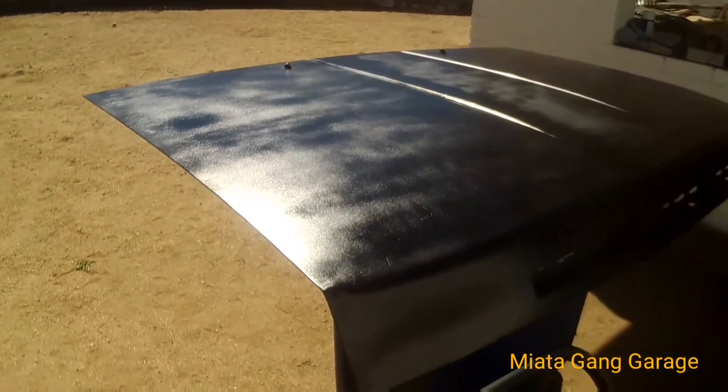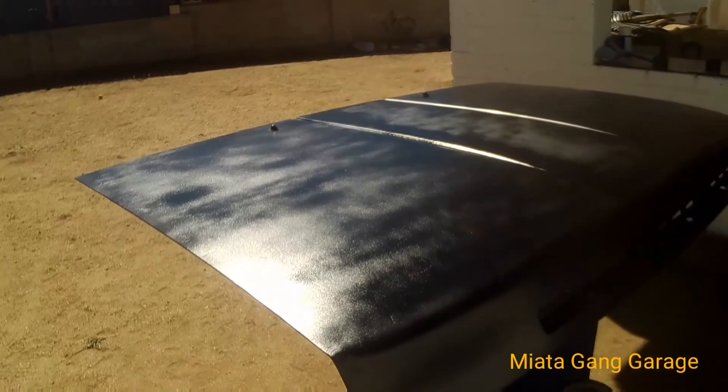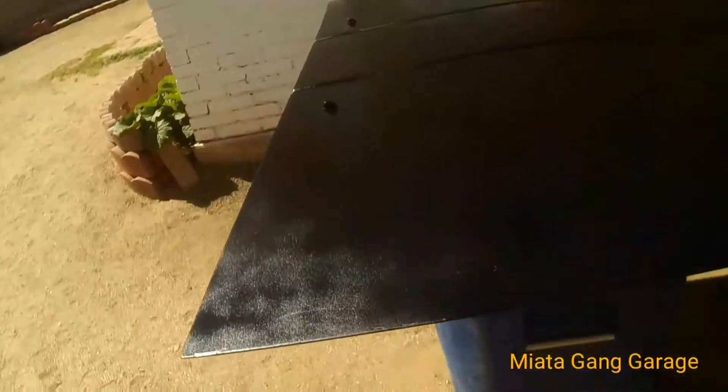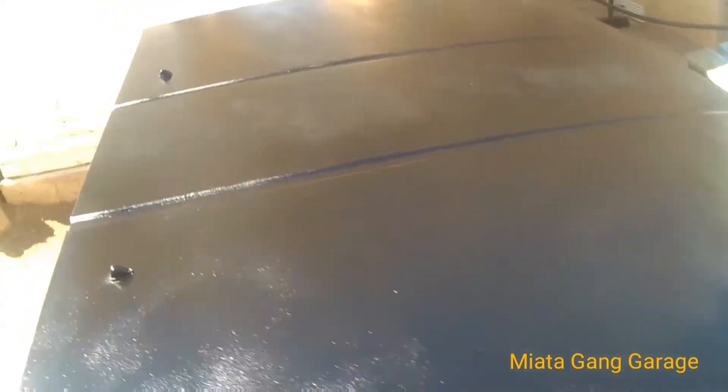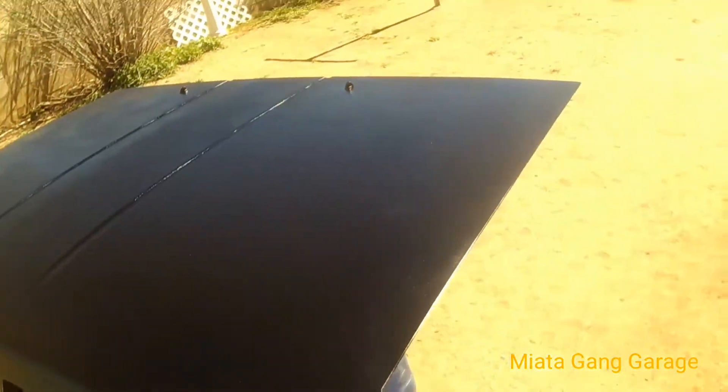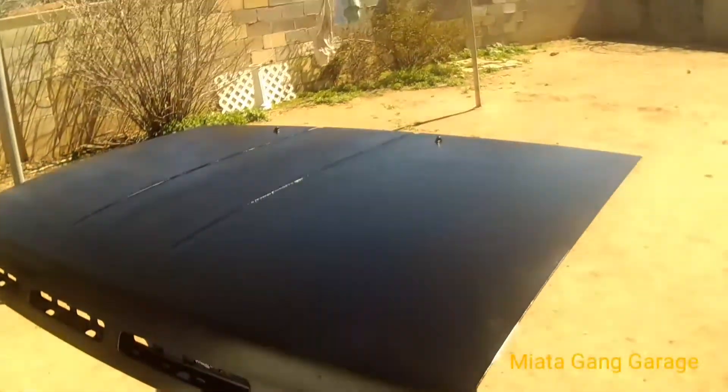You can kind of see the lines but it's just wet right now — once it dries this stuff forms together pretty good. Still a little wet — we just hit it with another coat. Once all this dries, I'll probably let it dry for like a couple days, maybe even a week. Then I'll hit it with color sand — probably get like 1000 or 2000 grit sandpaper and touch up all these rough spots. I'm kind of happy with it but not really — I'm a bit of a perfectionist and don't like my stuff looking like rattle cans. But it is what it is.